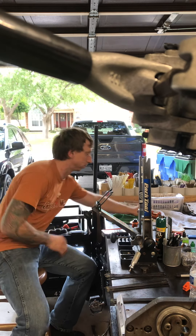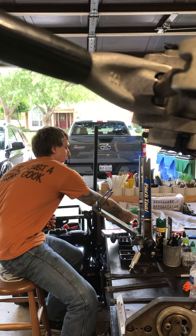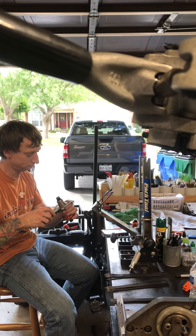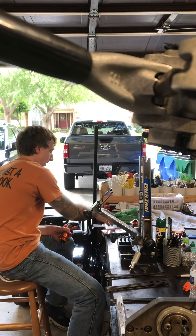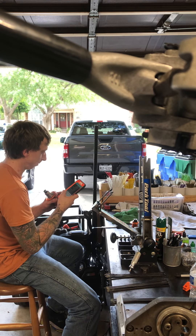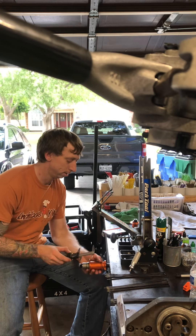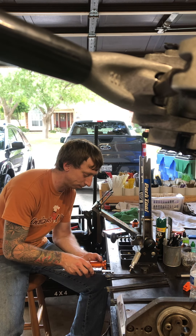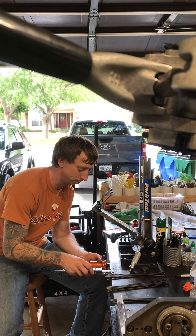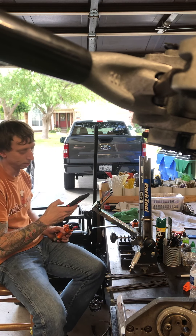The flanges are the same height front and rear — that's nice. For the offsets, this particular calculator is different — I like it. It measures from the outside of the hub to the center flange, not center of axle to flange. There are different ways to measure; I like this one best. It works very well for me. The measurement comes to about 38.88, so I round up — doesn't matter.